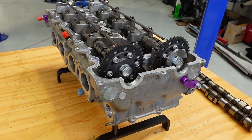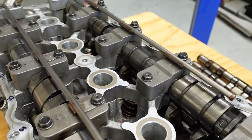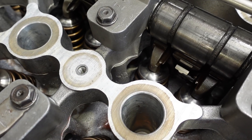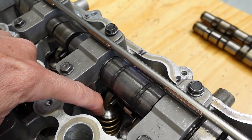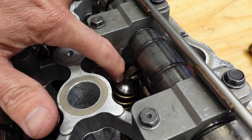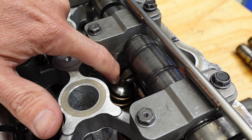Let's have a look at the cylinder head as we've received it back from our engine machinist. The first thing I wanted to check was the location of those shims relative to the retainer lips. This is number two cylinder, the exhaust side — the one where we had our issue. And surprisingly, even after the issue we had, just using the tip of my fingernail, I straight away found that the exhaust valve shim on number two cylinder is physically still below the lip of the retainer.